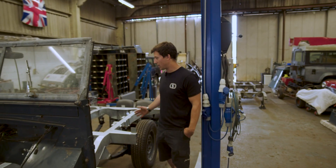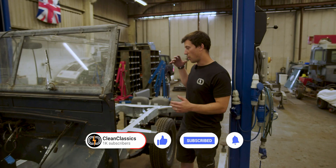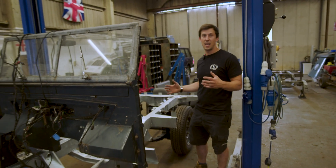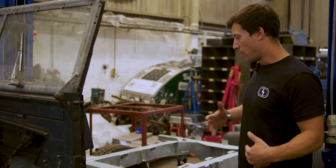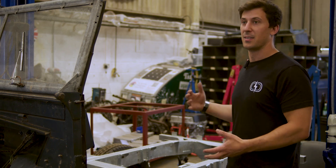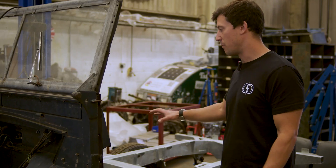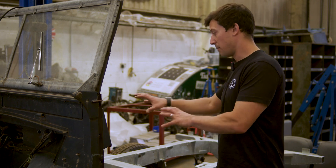We've also been doing a load of work on the CAD for the Series 1. Last week Alfie was working on the under seat boxes — the design is now together and looking good. What we do now is once we've got the tub back on and we can line the seat box up, we'll do a load of physical modelling just to ensure the design fits — we've got scan data which gives us a good guide. We measured the car before we took it apart, and now we've got an actual design together we can model in cardboard or whatever suitable materials to ensure what we've designed is going to fit nicely to the car with minimal hassle the first time around. Sam has done a cracking job of getting the subframe rails — same design as the Series 2s and 3s but needed a load of changes on the Series 1 — so we're going to physically model those up as well.